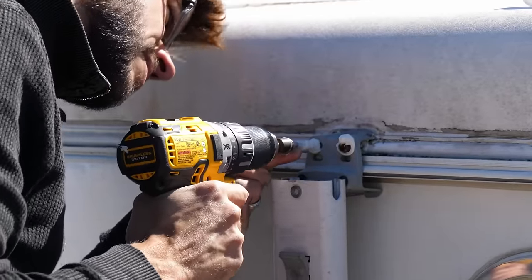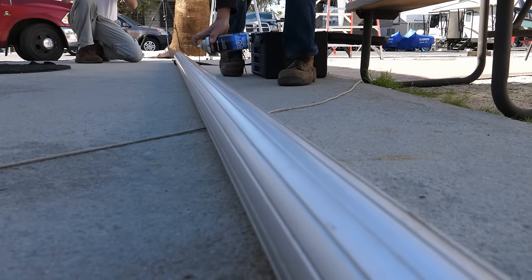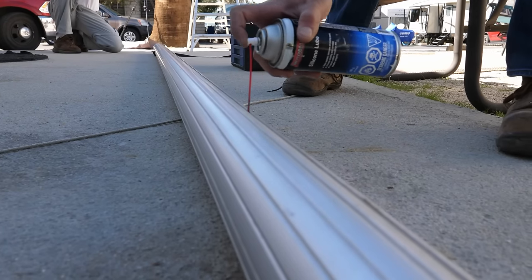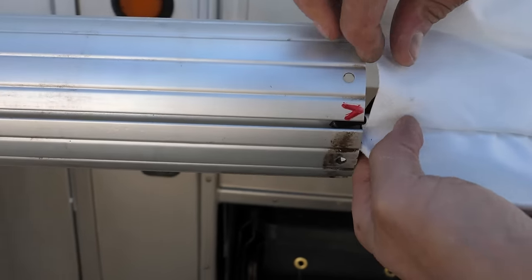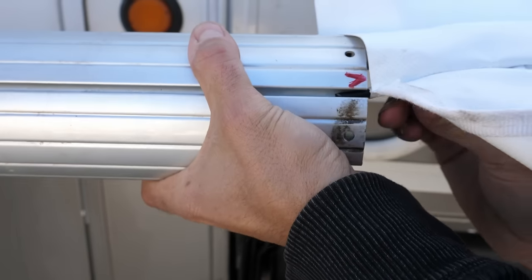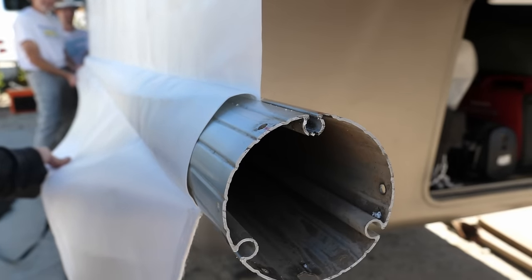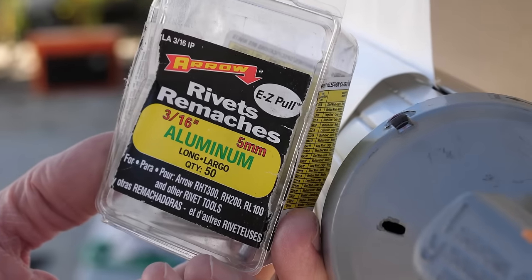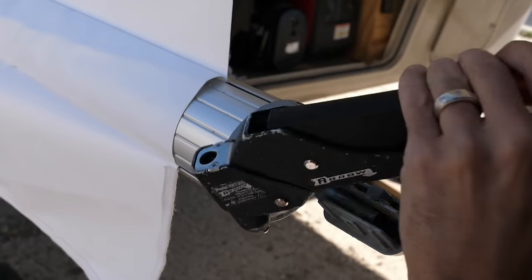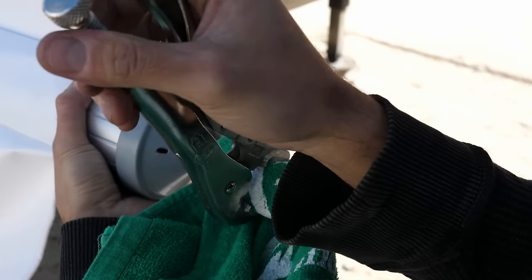Once in the track, we reinstalled the awning arms and applied a generous bead of caulk to the screws to help seal them. We then reinstalled the tube on the new fabric, using silicone spray on the awning tube tracks for both the awning and valence to assist with sliding the new fabric on. Our A and V marks came in handy here to make sure we installed the awning and valence in the appropriate tracks. Using three people, we slid the tube onto the new fabric. The cap and spring assembly were then reinstalled to the tube, lining up the marks from before, and the cap was secured with three new rivets.